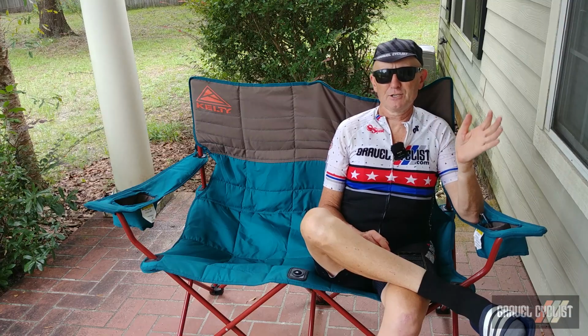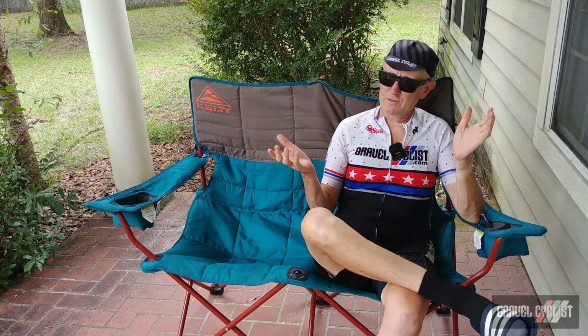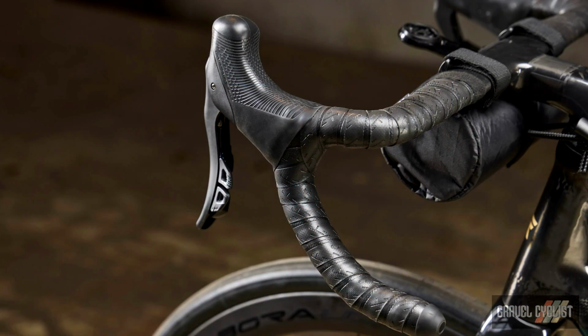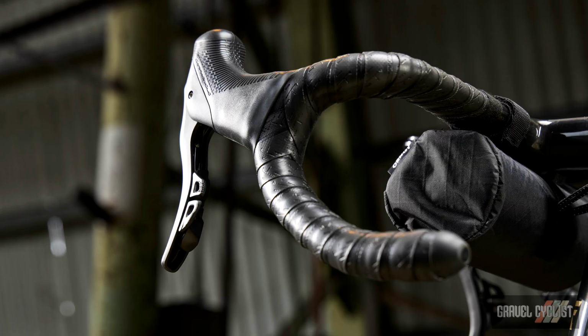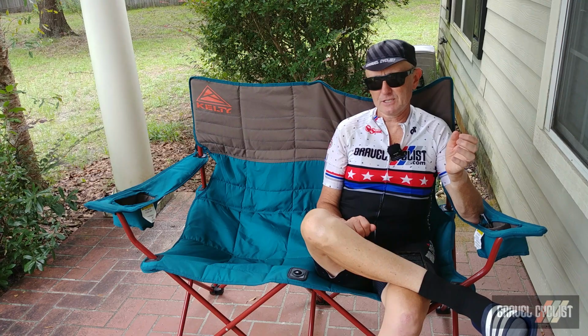The Speciale shifters with their matte black treatment feature an ergonomic and comfortable grip. Very important for those of us who don't wear gloves on the bike, unless it's really, really cold. Along with a redesigned brake lever that allows you to adjust it to bring it closer to the handlebars for a greater variety of hands. Campagnolo reckons you'll get 2 years out of the shifter batteries, and the claimed weight of 506 grams for both shifters. That weight does not include hydraulic hoses, etc.